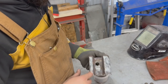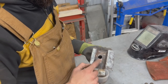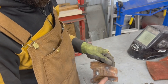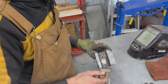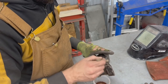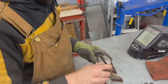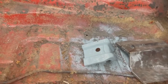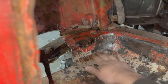I cleaned this up — there were a few little holes here and there, and a bigger hole here which I welded. I put a little circle of sheet metal in, and there were pits here that I welded as well — and that's going to be it. Now I'm going to rust convert it, we're going to paint it, and then we can put our floor on it and put it in the car. So these are painted — I painted the back of this where they're going to overlap and be spot welded — while I'm waiting for them to dry I cleaned the corner here to confirm it's solid, so I don't need to do anything about it.